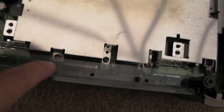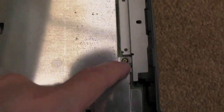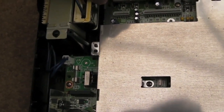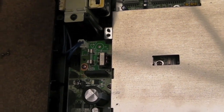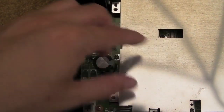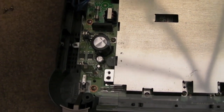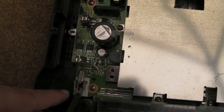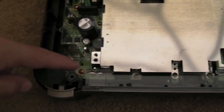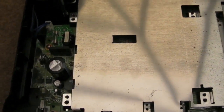Once your CD drive is out, you want to get all these screws from the shield in here that hold the board in as well — there are screws all over the place, one back there, one hidden under there. Make sure this is disconnected from the mains while you're doing this because all this area is going to be live. When removing the CD drive, just watch you don't drop a screw down there, as a screw floating around could damage it badly.